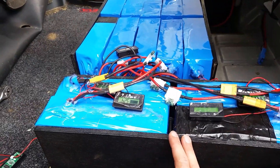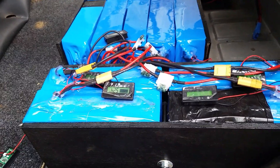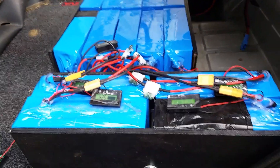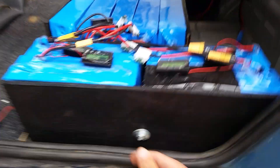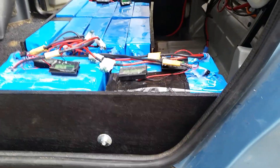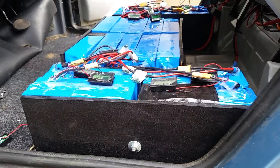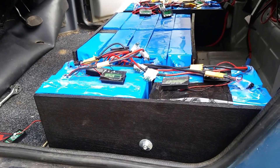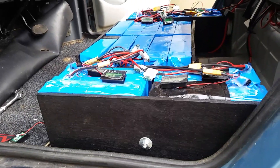I've been doing some testing on fast mode — the main forward drive — and I actually achieved only 17 miles less than when I tested it with Eco mode. I was able to do 131 miles from 54.4 down to 45.2 volts, which was pretty amazing. So I only lost 17 miles by driving with my foot to the floor. I'll include those results in this video so you can see the comparison — back to back, driving fast versus driving in Eco mode.